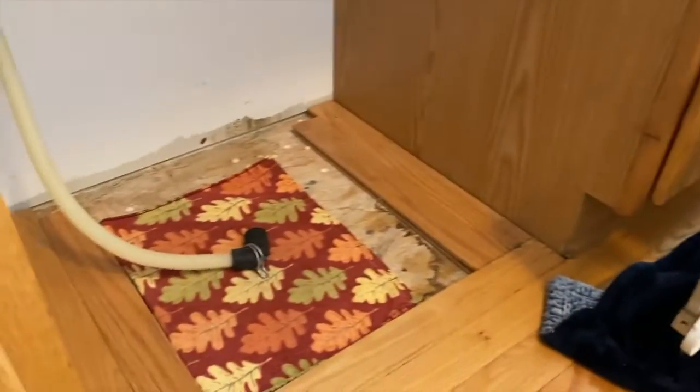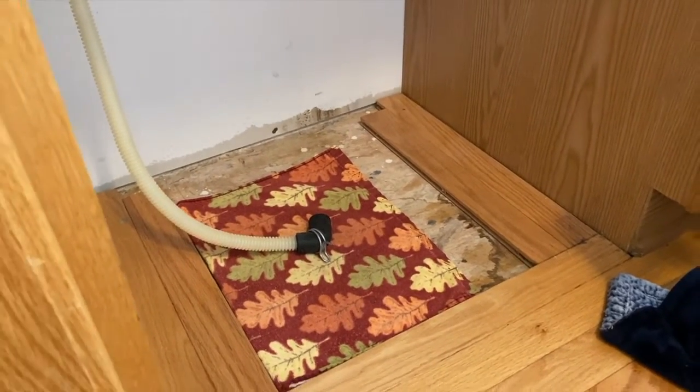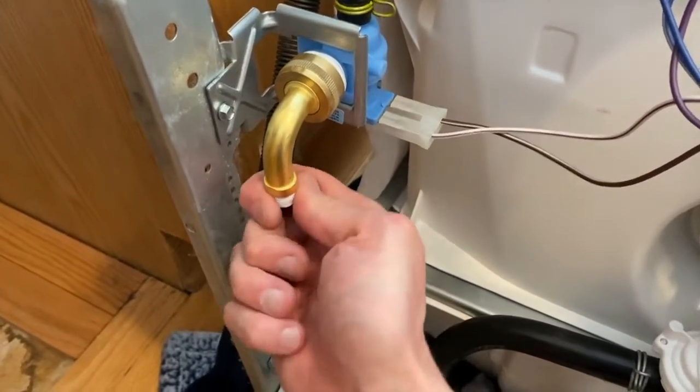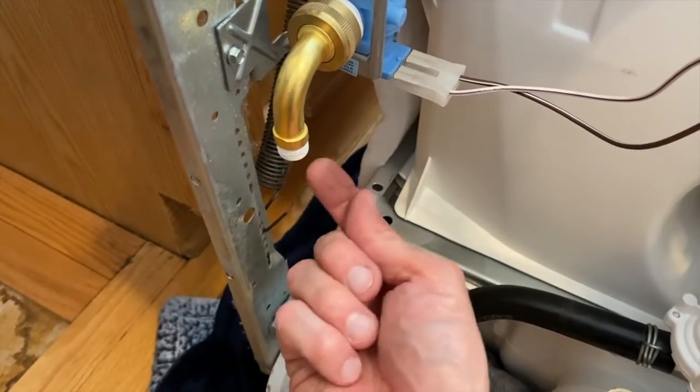Just like that. I spent about 1.5 minutes and vacuumed out the entire insert area where the dishwasher goes. What we'll do now is lift it back up and carefully slide it back into place. One last thing, prior to putting the dishwasher back in, I applied some more Teflon tape in a clockwise manner, in the same direction we will be tightening that water fitting.